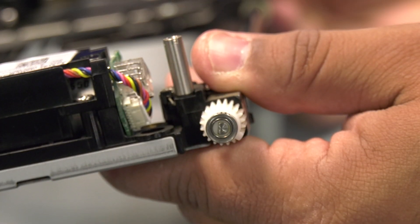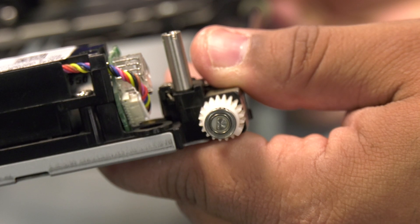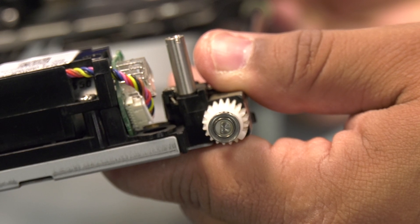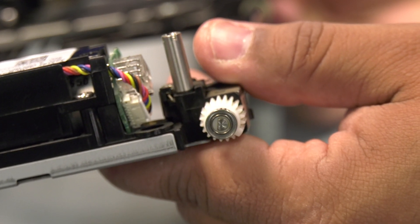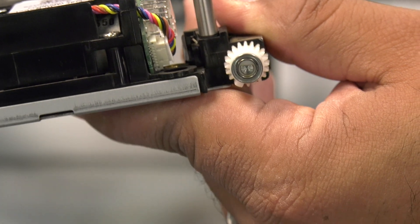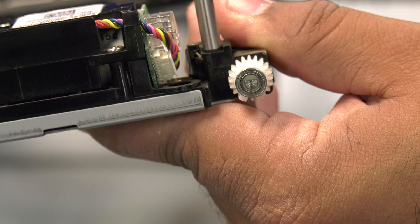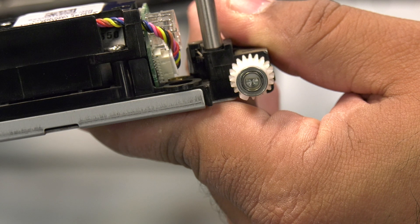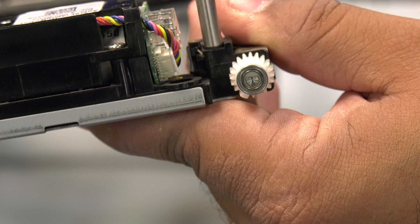With the replacement picker, first verify that the gears are in the correct position to properly be set into the top of the four picker tracks. The gears on the four corners of the picker are keyed and those keys all need to go down together and roll into the notches in the tracks at the same time. To ensure the gears are all in the correct position, inspect the end of the bar where each gear is — you will notice a silver half circle located there. This half circle should be facing with the flat side towards the top so that it resembles a smiley face. You need to ensure that all four gears have the same orientation simultaneously prior to installing the picker assembly. If your gears do not line up or you cannot get them all oriented correctly in sync, please stop and open a ticket through the Rocket Plus customer portal.